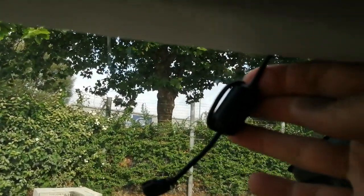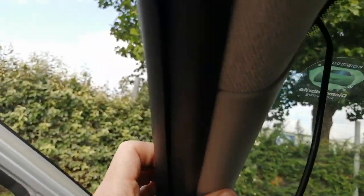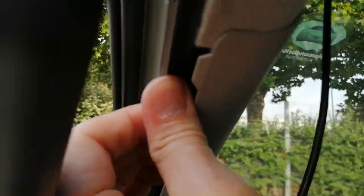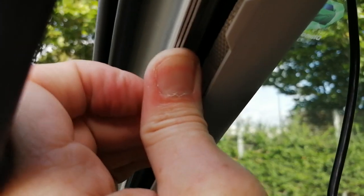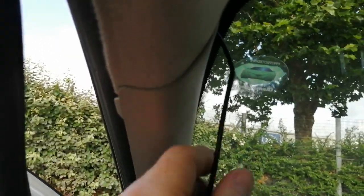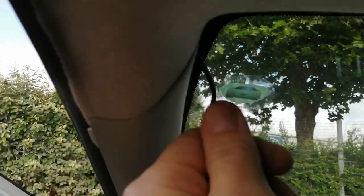We've tucked the cable up above the headlining, running all the way along next to the mirror and across to the A-pillar. Next, pull the rubber trim off the A-pillar — it can be quite sticky on a new car. If you flex the trim forward, there's an airbag behind there; don't worry, you won't set it off, but be aware it's there. Flex it forward and tuck your cable behind the airbag all the way down. If you have trouble feeding the cable behind the airbag, sticky-tape a thick cable tie to the cable and use it as a guide to poke it through — it's a bit fiddly but it's the correct way to do it.